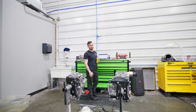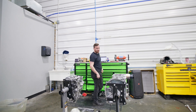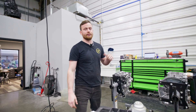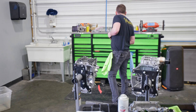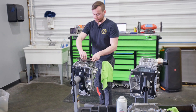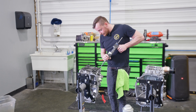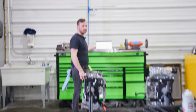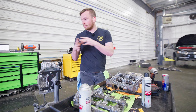The proper way to do this is to pull the engine out, take the timing back off, and redo the clearances that way — not with the cams in the car, which is really sketchy. Even after 10 years of doing this, I always pull up the factory data guide to reference it if I need to. I'm applying RTV to the gasket on both sides — this is a thicker multi-layer steel cometic gasket than factory, because we had the cylinder heads shaved down and that's what they wanted us to run.